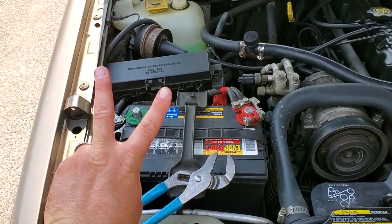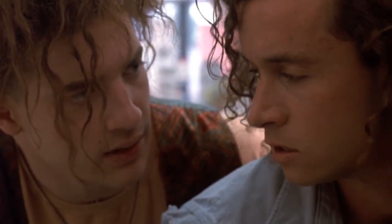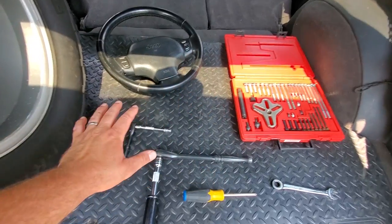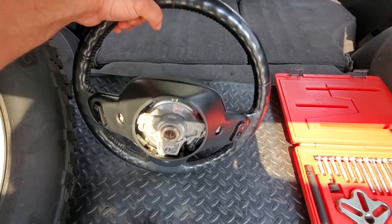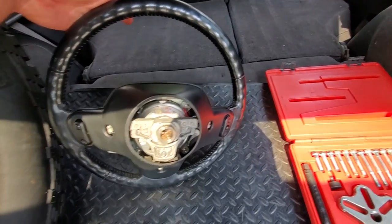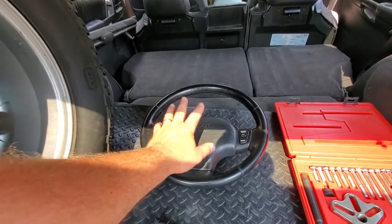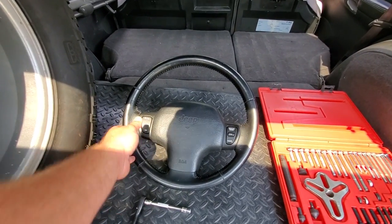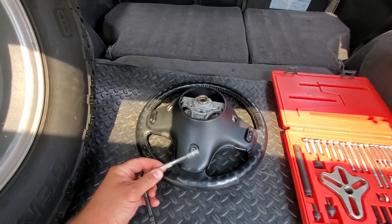Once that is off, you've got to wait two minutes for the capacitors and the battery to dissipate that energy. While we're waiting, let's look at all the stuff we need for our swap. First thing is of course the steering wheel — this was an eBay score. It's kind of expensive but it's actually pretty perfect. It's got steering wheel controls just like mine. There was none in the yard, none on Facebook Marketplace, so I went to eBay. The next thing you're going to need is an eight millimeter socket for the airbag screws — take these off and that will pop off that airbag. Next thing is a 21 millimeter on a socket with an extension, because when the airbag is out you've got to get in there around the rim of the steering wheel.